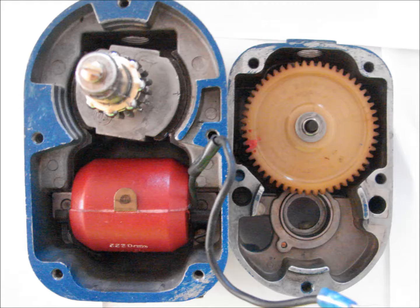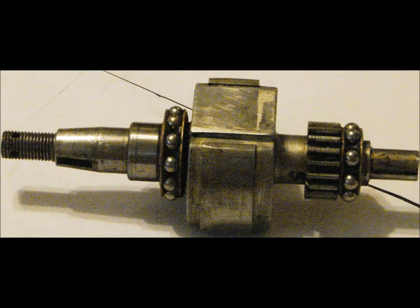Rotation can damage the Magneto housing. Once the two halves are split, discard the gasket if used. No gasket was present on this Magneto. With the halves split, remove the rotor and place it in a clean container. Take care to ensure the rotor does not come into contact with metallic shavings, dirt, or other contaminants.